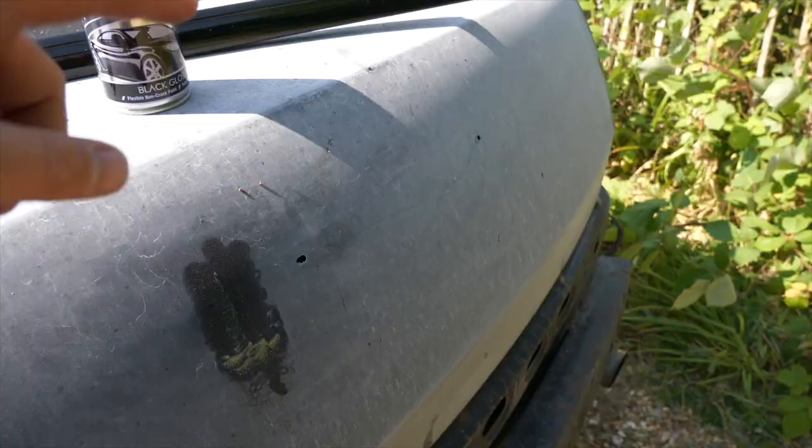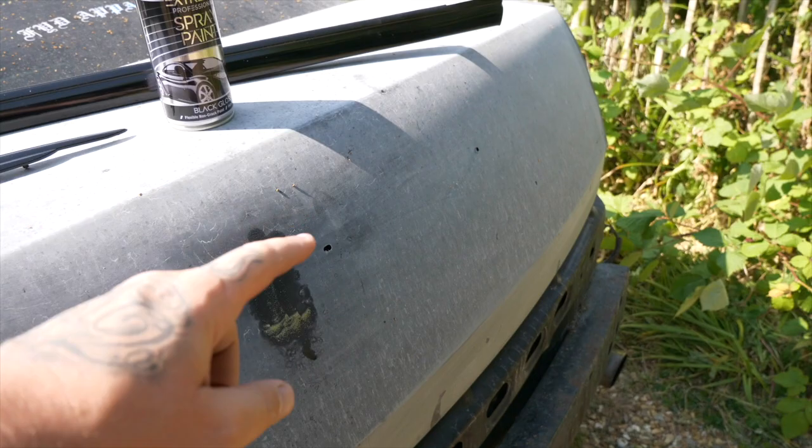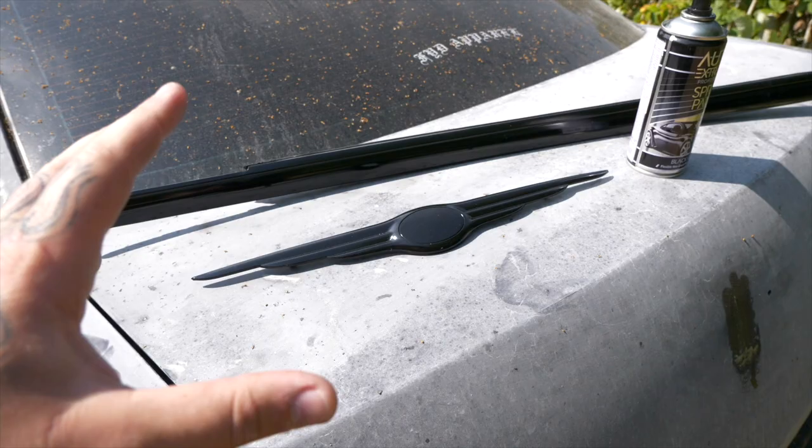As we're trying to do this on a budget, I thought multiple coats and sanding down the chrome would be the way to go. So what I did was sanded everything down. I didn't show this process because, to be honest, I didn't think it was going to work. But thankfully a lot of the paint has actually taken to the roughed up bits of chrome and we have a pretty good result. I did say I was going to have a go at wrapping this stuff, but for the sake of 15 quids worth of paint I thought I'd have a go, and if not we can actually wrap these bits when the time comes. We started off with the rear chrome badge, and as you will see, it is now completely gloss black. The process for this, more than anything, was doing multiple layers and having a pretty much perfect sanded down base to start with. So what I did was sanded everything down with the red scotch and 320 grit sandpaper, then went over it with some plastic primer.